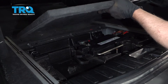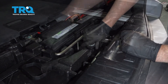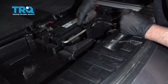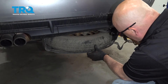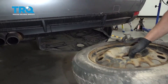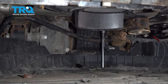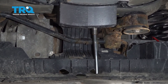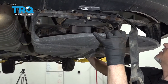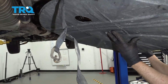In the back, lift this panel up and out of the way. We're gonna lower the spare tire, so loosen this up. Then take this and carefully twist it — this will lower the tire down. It's gonna be a little heavy. Pull the spare tire out. Through the base of the spare tire holder, use a 13-millimeter socket and take these three bolts out. Tip this down, twist it out of the way, and let it hang like that.